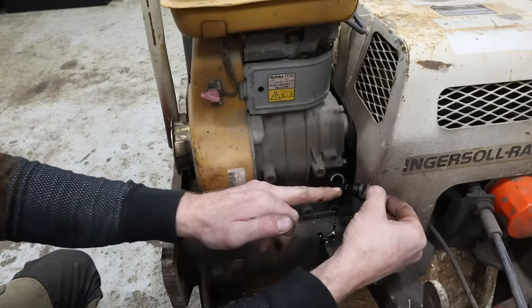All right, as far as those lines go, the only thing I can find, I've got this automotive PB550. Not sure what it's for. Looks like an airline of some kind, maybe. It's not flexible enough. But I have this semi-truck airline. It's a chunk of used airline. It's plenty flexible. And so, for this moment, I already made one of them. So this line here basically fits onto, I stuck some caps on these for tonight, here and here on these barbs, and then it compresses into this nut here. And so it's a compression style fitting.